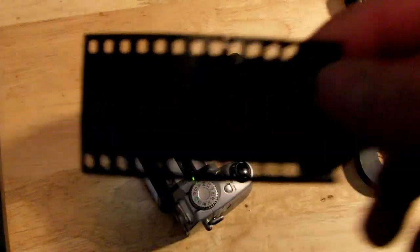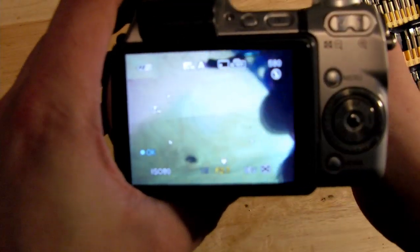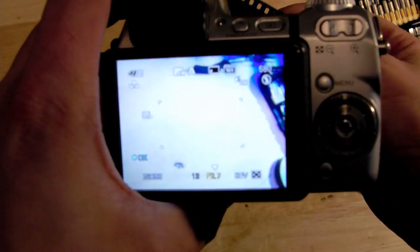In order to shoot true infrared with no visible light coming through, you can use unexposed developed film as a filter. This unexposed film will block visible light but allows infrared light to pass through. The unexposed but developed film will appear dark brown, almost opaque, in visible mode. Once switched over to infrared you will see the infrared lightness of objects around you. The color won't be true color because we can't see infrared, but this will give you a good idea of the reflectiveness and transmission of infrared light through whatever you happen to take a picture of.